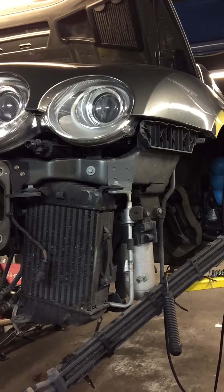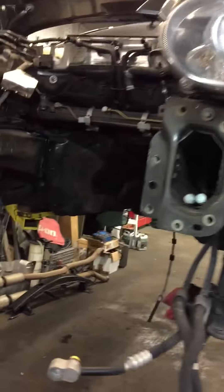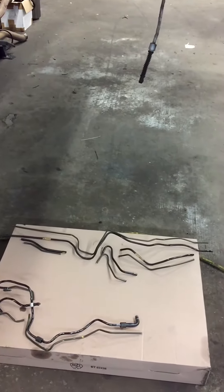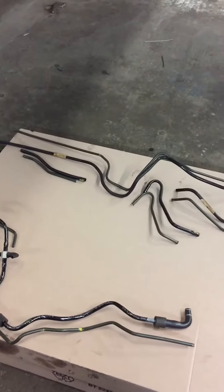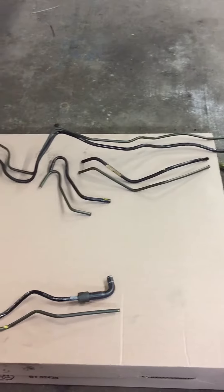This video will show the new metal lines on the body and a smoke test to show it's not leaking. I removed all the plastic lines from behind the rack and pinion and remade them out of coated steel lines that will last the life of the car. All these plastic lines are on Continental Series Bentley cars from 2004 and up. These are the lines that are behind the rack and pinion.